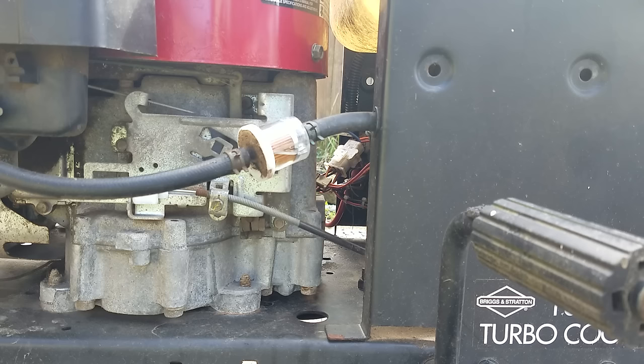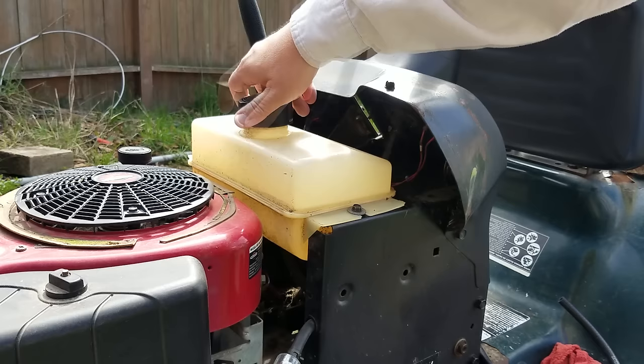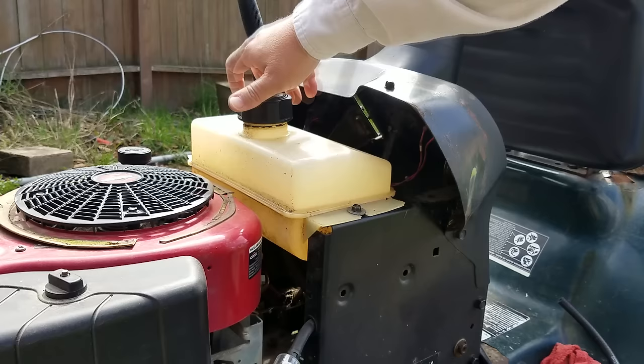The first thing we've got to do is get the fuel out of the tank. I've got a half tank of fuel in here — really good fresh fuel, ethanol free, which is what I prefer to run in these motors. Today's gasoline is just terrible and it's really hard on equipment. So what we're going to do is dismount the tank, drain it, and then replace this fuel line.